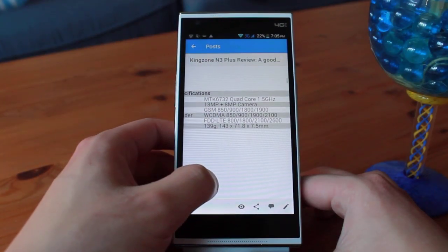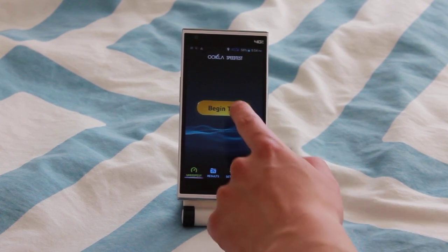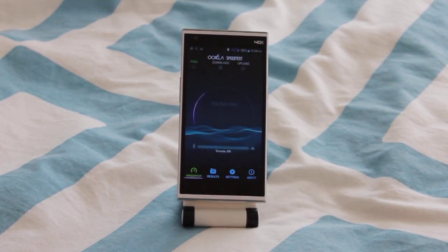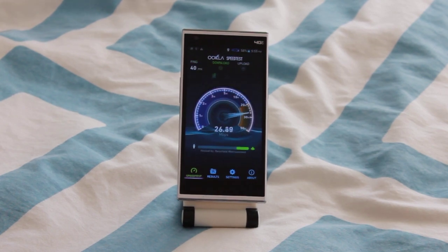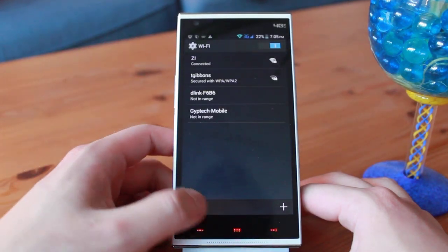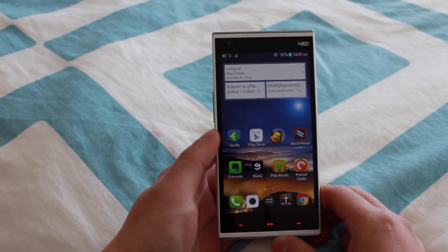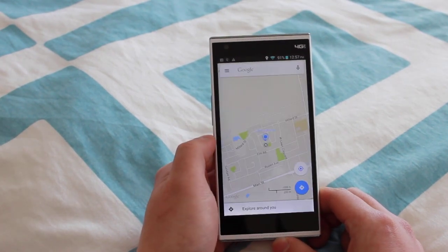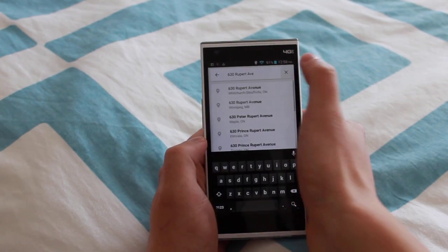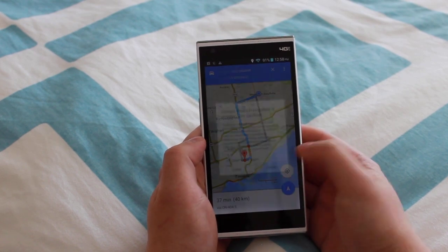This phone supports quad-band GSM, quad-band WCDMA, and FDD LTE bands 1, 3, 7, and 20. I was able to get LTE very quickly after changing a few APN settings. Reception is good, but the phone did switch to 3G from LTE more often than I expected, probably due to the towers in my area. I performed multiple speed tests in different areas of Toronto, Canada and obtained speeds anywhere from 25 to 36 megabits per second, which is pretty good. Wi-Fi performance is also good — I get reception anywhere in the house even with my wireless N router in the basement. The GPS locked on almost instantly and never once lost signal. I used it to navigate to work for about one hour and it always stayed on course without deviating. The GPS problems from the MTK6592 chip have largely been fixed in phones containing the MTK6732.